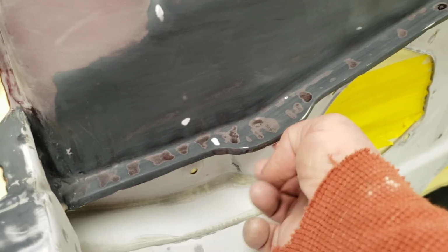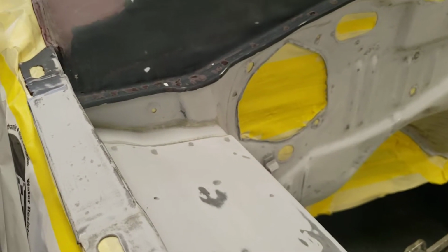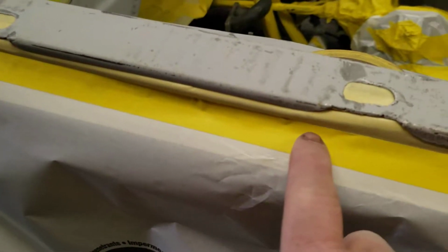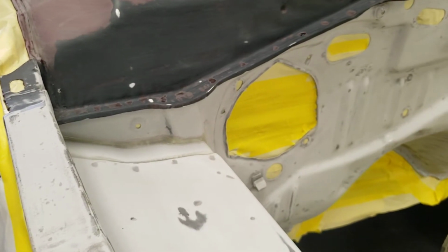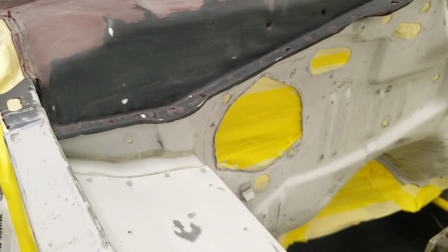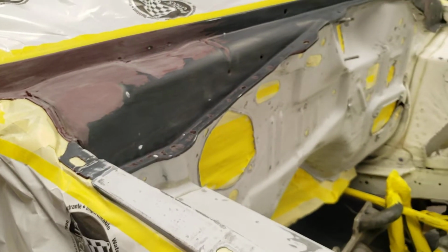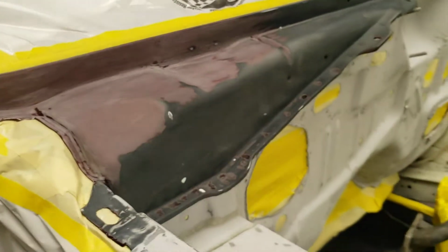I use a lot of sandpaper sand in there, and use a red Scotch-Brite, and I blow it all out. And you know, I'm not gonna lie to you, I know there's probably places up in there where it's not sanded exactly good, so I didn't want to back tape that with 2-inch tape like I have this area, because if I pull fresh paint off, well, you know, fresh paint doesn't bond good until it's cross-linked well. And you know, about 12 hours at 72 degrees is probably the minimum that you want to give it to make sure it cross-links fully.